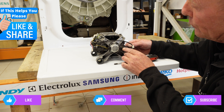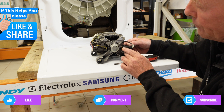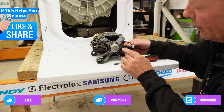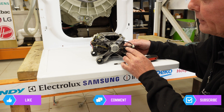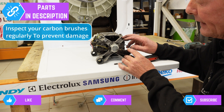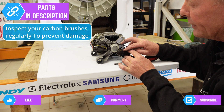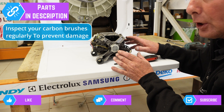I'll quickly take the carbon brushes off. If you look closely at the side of this carbon brush you can see bright brass - bright because arcing has come across to the casing. It didn't necessarily cause a direct short here, but it may have tracked across onto the casing causing it to trip the electricity. This is why I suspect the circuit board is damaged. We're now going to replace the motor.